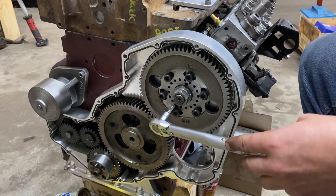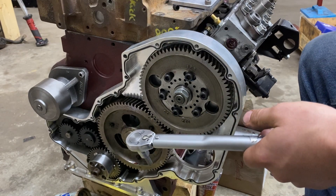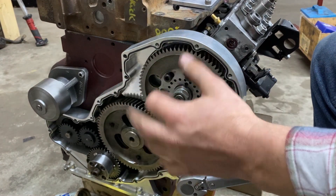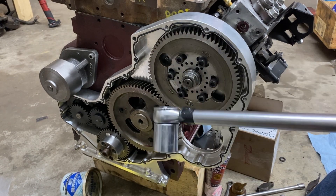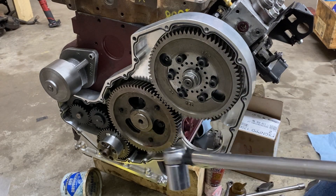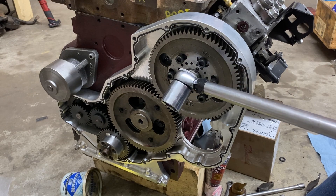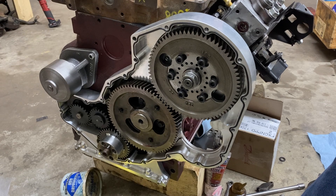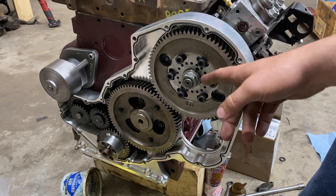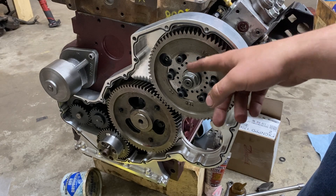As for the little center bolt, I'm not sure of the exact torque, but I'm going to say it's the German spec — guten tight. Don't go too crazy on it though; use your internal built-in torque wrench. With everything in, you can put your torque wrench on here and torque it to 144, 150, or 160 foot-pounds — whatever you prefer. I put some ARP moly lube on the threads of the shaft and the bottom side of the nut to get a more true torque. Going in totally dry, 140 foot-pounds may not put the actual proper clamping load on things. If you've ever slipped timing, you hate doing it and never want to do it again.